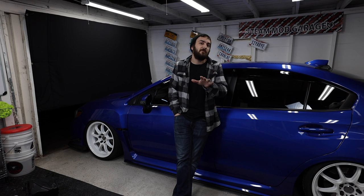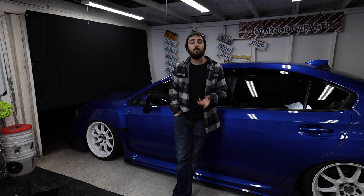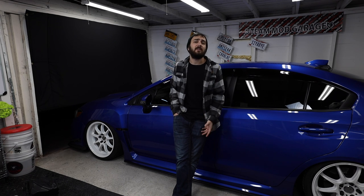For the STI, the OEM tune from Subaru runs a little lean. When you throw on that stage one tune, your car is going to be running a little more rich in a good way. It's nothing too crazy that will damage the car on OEM tune long-term, but Subaru has to meet EPA and federal emissions regulations, so they run it lean to meet those standards. The OTS stage one tune richens the car up a bit, making it more reliable. Pro tunes will always be better than an OTS tune — even an e-tune from a good e-tuner can provide valuable insight.